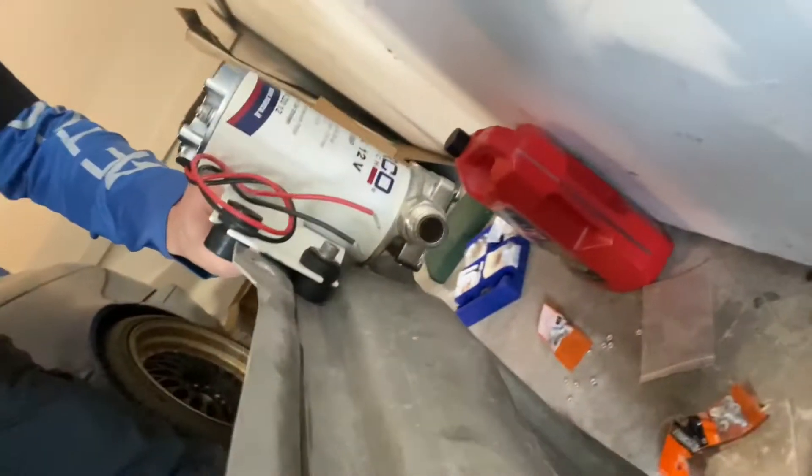What's up guys, we're back today with another video on the bimmer. Today we're getting into some more serious stuff. We actually got in the mail a turbo oil scavenge pump, and what that's going to do is pretty much solve our gravity drain issues. My turbo is too low to gravity drain from the turbo to the oil pan, so I chose to run a scavenge pump. I actually got it mounted up — we'll talk about it here in just a minute.